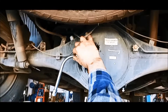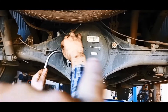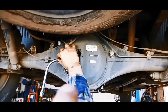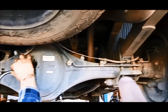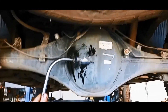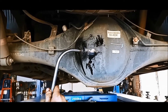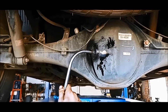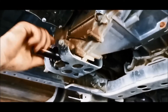You can see even the factory magnet has collected a lot of that rubbish. Now when you're filling your diff, you always want to leave a little bit of time for the thick oil to actually travel down the axle tube. Quite often people get too excited and don't allow that oil to flow all the way along. The oil level should be almost halfway up the axle tube — you want to make sure the bearings at the ends are getting oil as well.